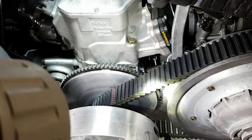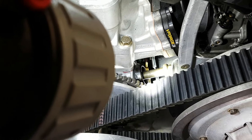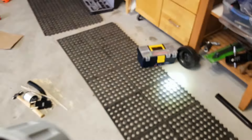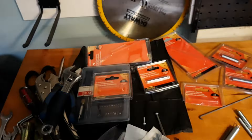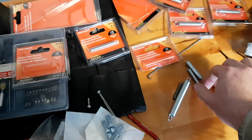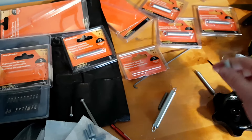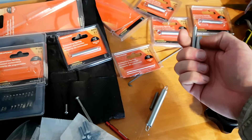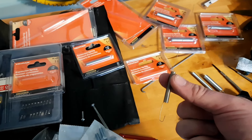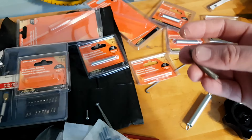Here's the deal though: that's zinc, so it's going to rust. If I don't keep it lubed up with an anti-rust product, that's not cool. And to get the right spring that doesn't add any pressure to the throttle, I had to try out a lot of springs — many different sizes, because I had no idea how the spring was going to feel. I ended up going with something lighter — this one is deceptive because you'd think it's stronger but it's actually lighter. After all that, I actually found a spring from an old carb on a snowblower that would have been perfect, but I didn't know I had it.